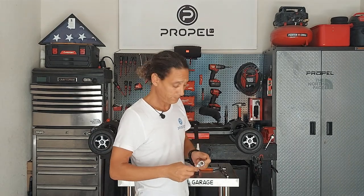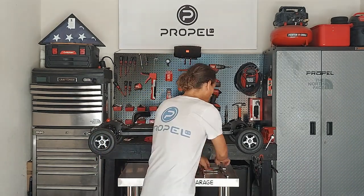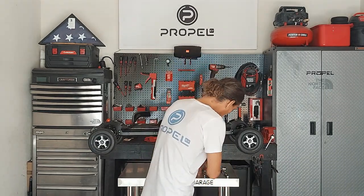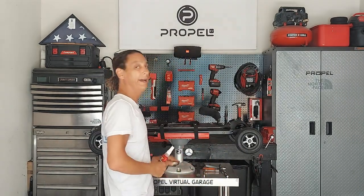Okay let's get right into it. We're going to need a couple tools. We need the standard 17 millimeter for taking the tire off. We need a 10 millimeter on an extension on a quarter inch drive - an important note is that it has to be the short one, you can't use the long one. I've tried close to eight or nine and I have three that work. I found one online for two dollars on Amazon and I'll add that link in the comments. You will need three Allen wrenches: two fives and a four. A soft hammer can come in handy, and of course Loctite and a parts dish.